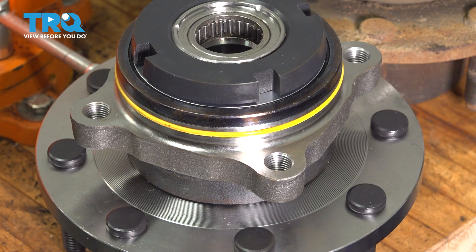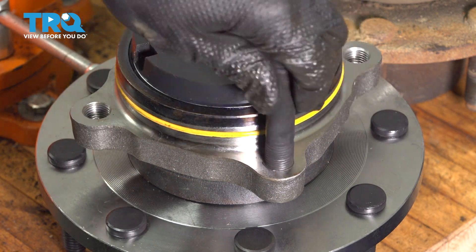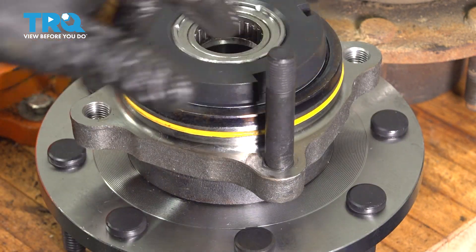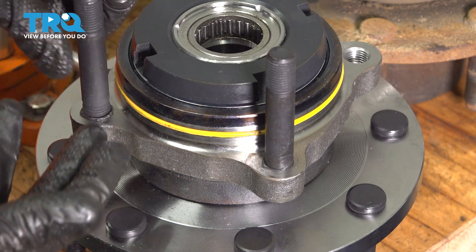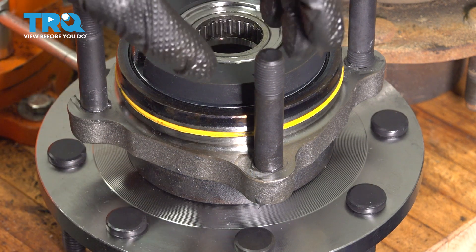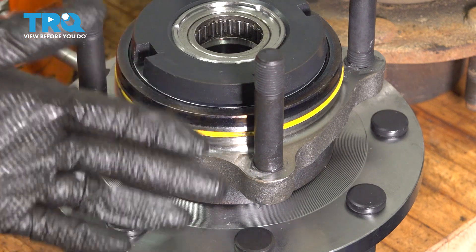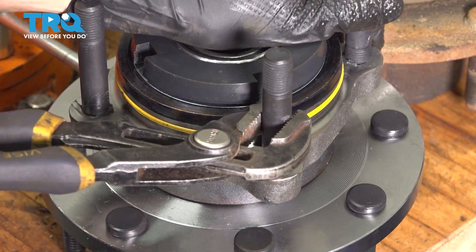What we have to do now is install the studs that are going to hold the wheel bearing onto the knuckle — we just have to thread them in to the wheel bearing. Put a little bit of grease very lightly on these threads to allow it to slide in smoothly, and that way I can more easily snug this down because I don't have anything to grab onto these with other than just pliers. These don't need to be extremely tight because when you put the mounting nut on this side, it's actually going to pull the entire stud as you tighten and put torque on these threads — so it will tighten both ends of the stud. Just do your best with pliers and snug it up.